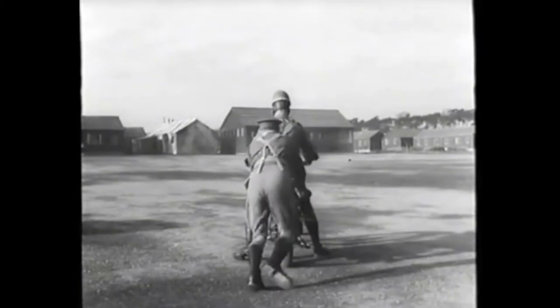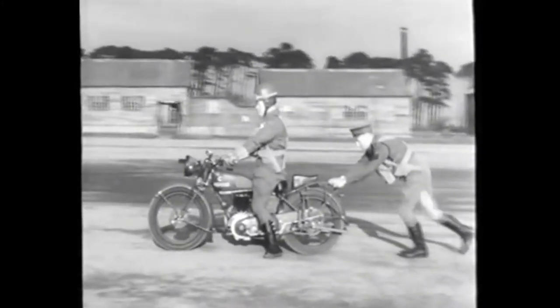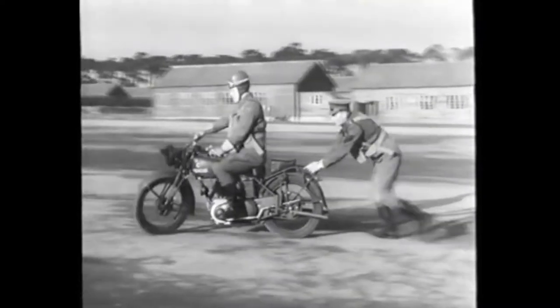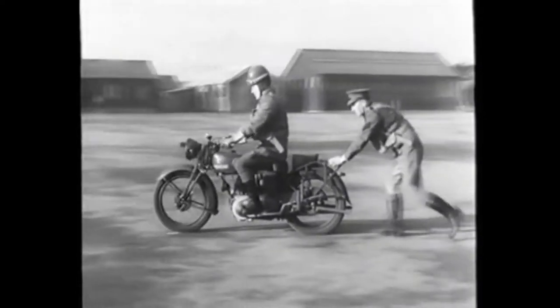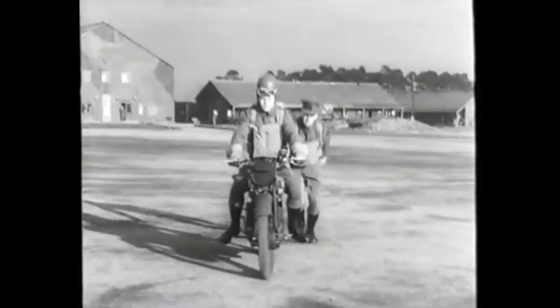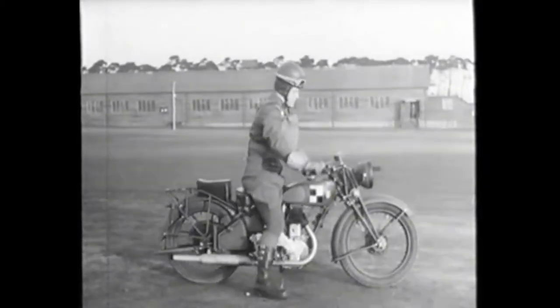By taking your first trip under man instead of machine power, you can soon learn to keep your balance, because you only have balance to think about. The novice wobbles a bit on his first attempt, which is quite natural, but he still keeps his feet on the footrests. It is surprising how quickly the balance is found, and with that discovery comes your confidence. In addition, at this stage, you will learn to operate the brakes without looking or groping for them.